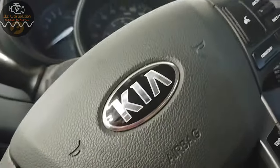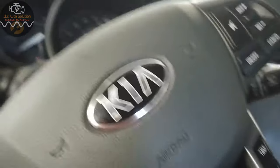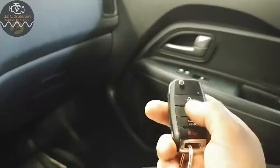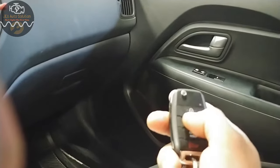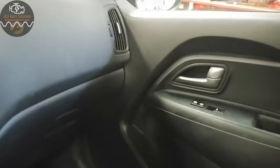In this video I have a 2014 Kia Rio and the customer complaint is that the door lock on the passenger side does not unlock. I'm gonna press a button and we've just seen it move just ever so slightly, but there's nothing happening — doesn't matter if I use the remote or if I use the switch. So the next step is I'm gonna remove the panel.